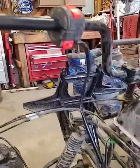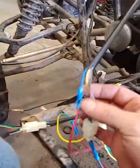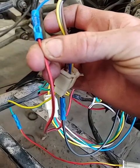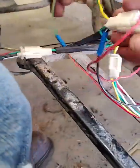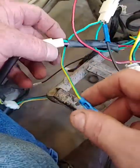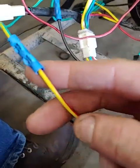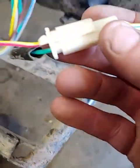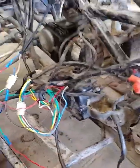We're neatening this up with some tape. For the starter to still work, you come out at the blue wire, connect a red wire to it, and put that onto the positive post of your starter solenoid. The other wire is the activation post — we snipped the existing green and yellow wire and tapped into the yellow and red wire. Plug this harness in — it leads to the solenoid, excites the solenoid, and tells it to start. Hopefully this helps somebody.